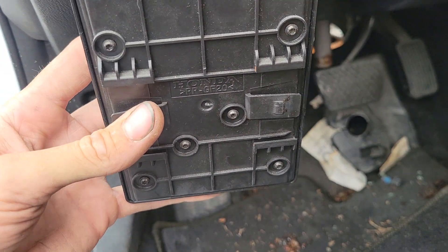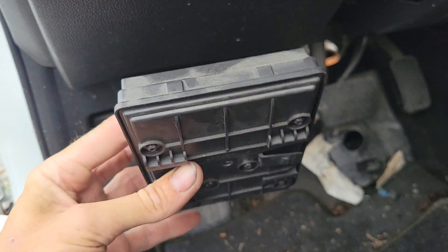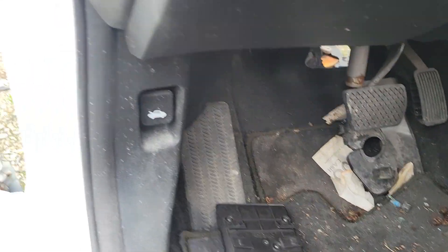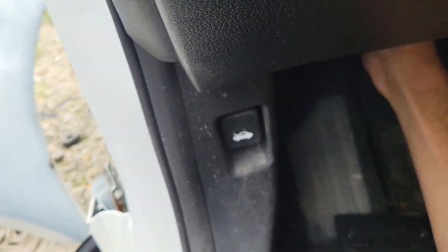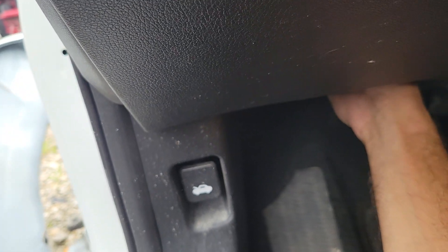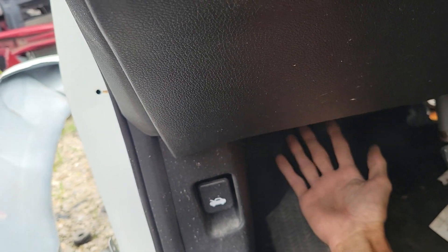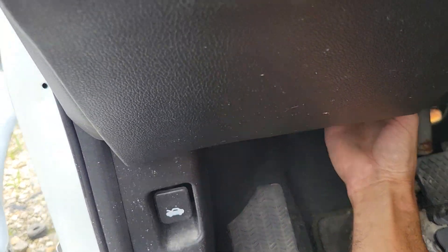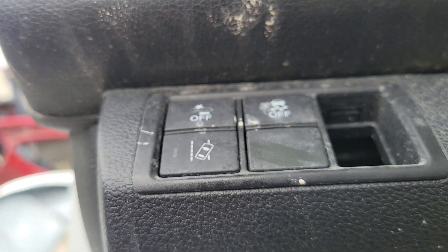It sits in a little bracket in this configuration with the plugs facing away from you. You'll have one little tab that you can feel. I had to get down underneath and reach all the way up behind in order to feel for this thing, because you can't see it from underneath. You'd have to really be way up under the dash or take a lot of things out of the way. Basically, you just come straight up from between the gas pedal or the brake pedal and this pad, come straight all the way up behind, and right in behind this general area you'll have that module and a little tab.